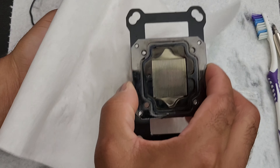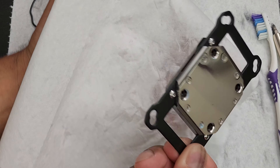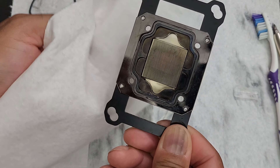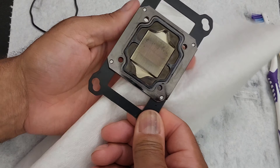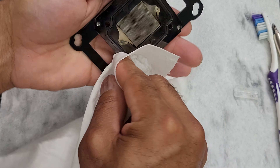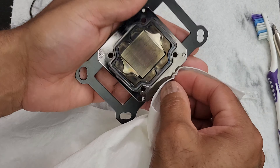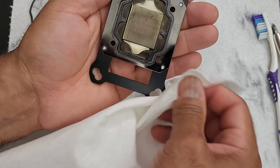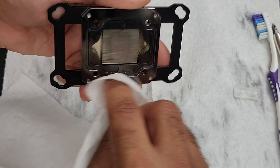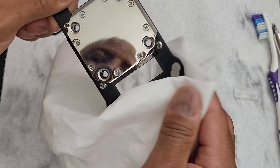The reason we use distilled water is because normal tap water has all kinds of chemicals and metals in it, and you want to definitely avoid putting that in your loop because not all metals work well together. For example, copper and aluminum don't do well - there's an electrochemical reaction that happens when they're in the same loop where the aluminum will basically dissolve and turn into mush if there's copper in there. Copper always wins. It's the same with tap water - there are things in it you just don't want in your loop. Never use tap water; always clean with distilled water.